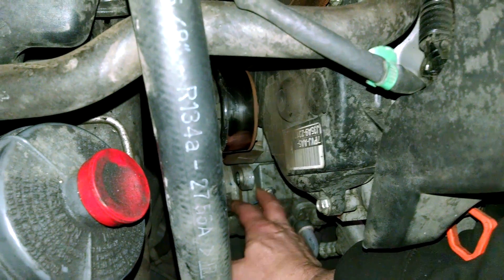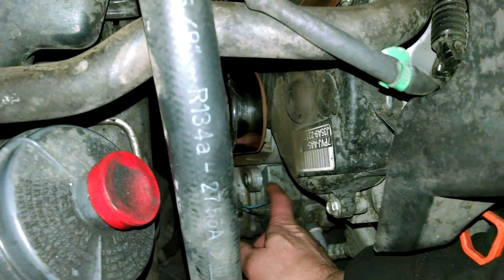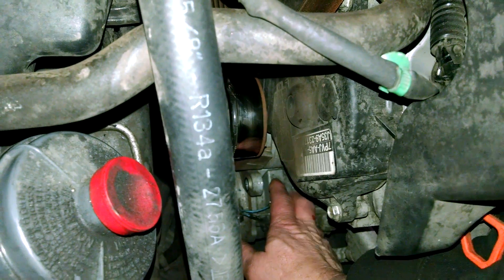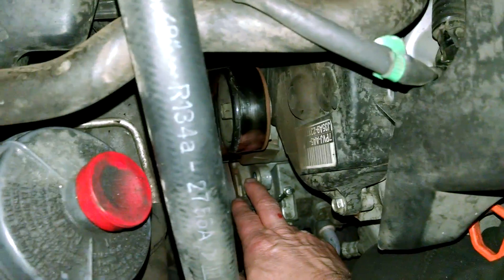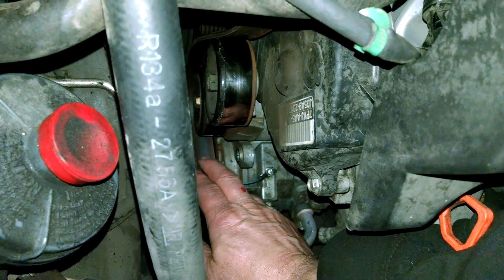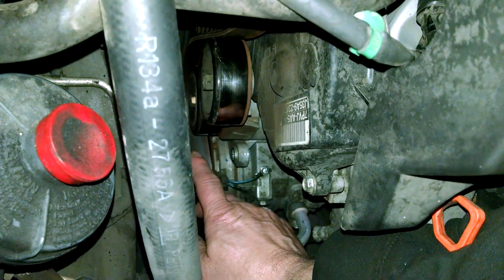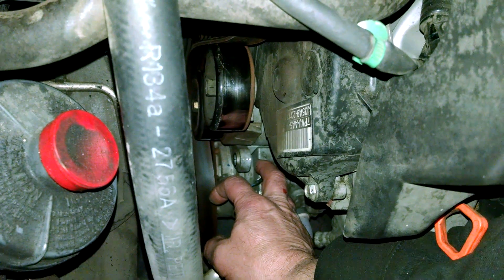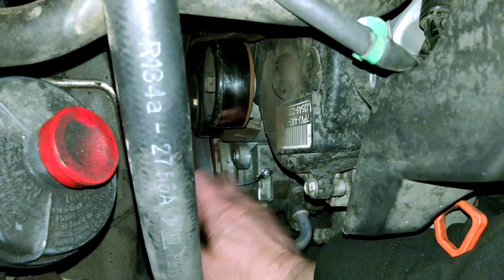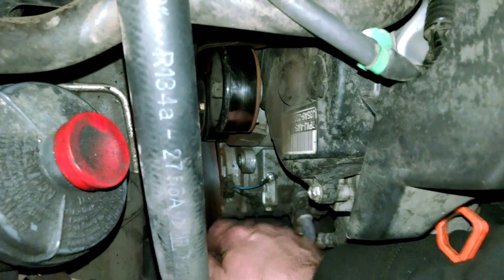It might go in okay without worrying about it. You can put a bolt through from right to left with a washer on it. On the left-hand side, use a socket that fits over the bushing and put a nut on the bolt, then tighten it up. The head of the bolt should push the bushing to the right into your socket, giving you a little free play to drop the alternator in place.